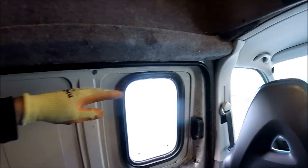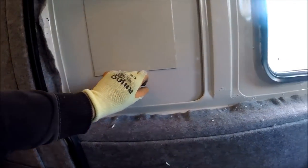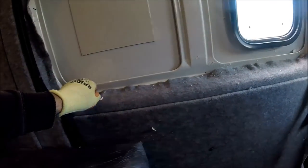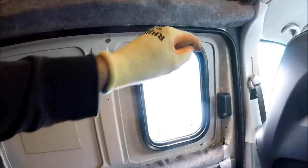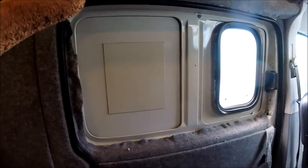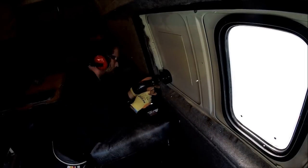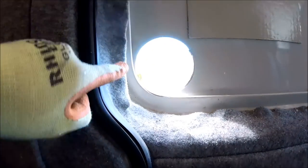Use the hole saw in all four corners all the way around, then we'll be able to do two cuts - one on the inner just where the hole is going to be, a couple of centimetres above the top line. We'll get the main panel out and then do a final neat trim once the main panel's out and we've got better access. You can see there that just by using the larger hole saw the actual curvature of the inner skin is pretty much matched up perfectly with the circumference of the hole saw. So it's just three more to go.